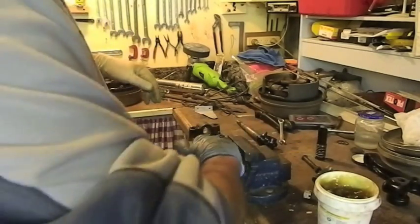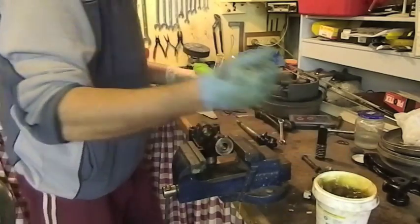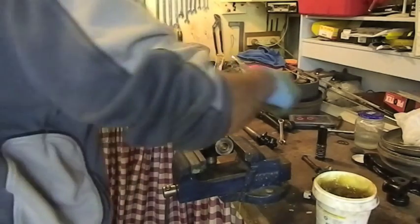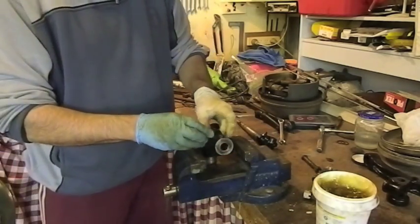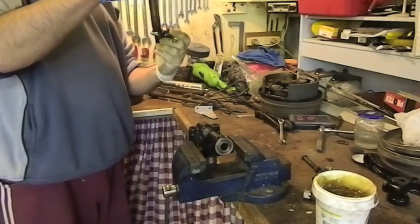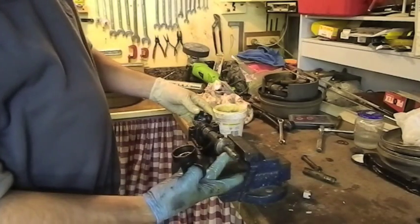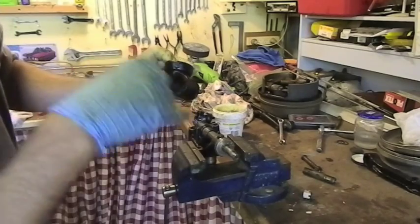I've taken a sickie from work today. I'm feeling a bit knackered but I can do bits and pieces in here. With these hubs, I've actually blown compressed air through where the grease nipples deposit the grease just to get rid of any dirty crap. There's an O-ring here - it sits down the bottom. Then we've got to put this sort of dust sleeve in. It's supposed to slide nice and easily and it slides in and locks itself there. Always blow compressed air through the bottom here so it can come out the side and make sure there's no dirty crap. The kingpins are scalloped and that scallop shows through here. The bush goes into the scallop so that has to be the right way around.